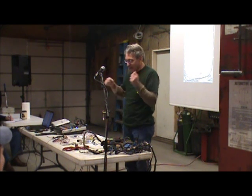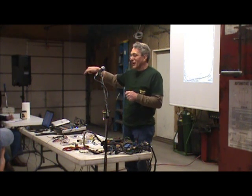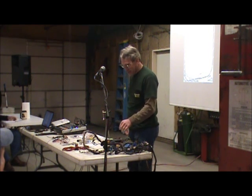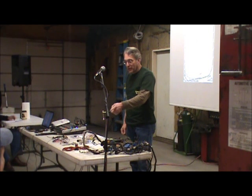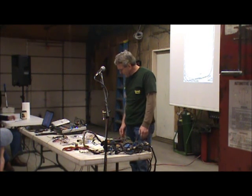And then I'm digging around trying to figure out what it was, and then I realized, yeah, okay, when you turn the switch to on, the white wire goes hot, and that's going straight to ground, and that's why it was doing that. So at least I understood why it was happening, and that was easy to undo that mistake. But again, in my opinion, as part of the work here, it should have gotten a new wire harness, because it was in tatters.